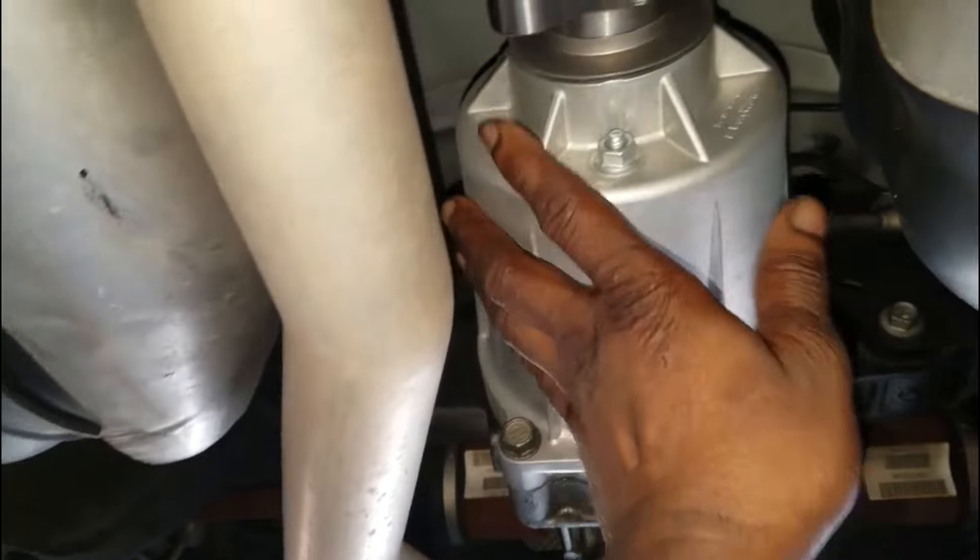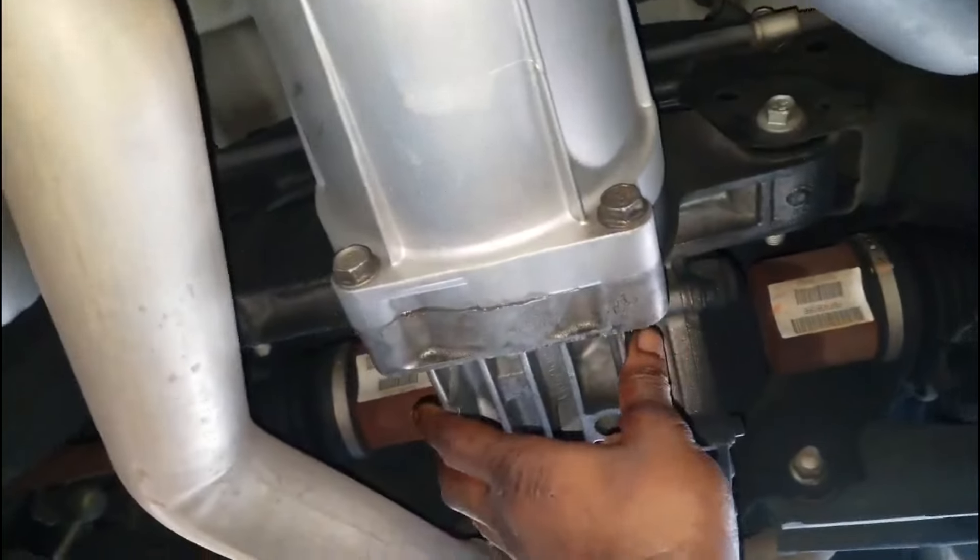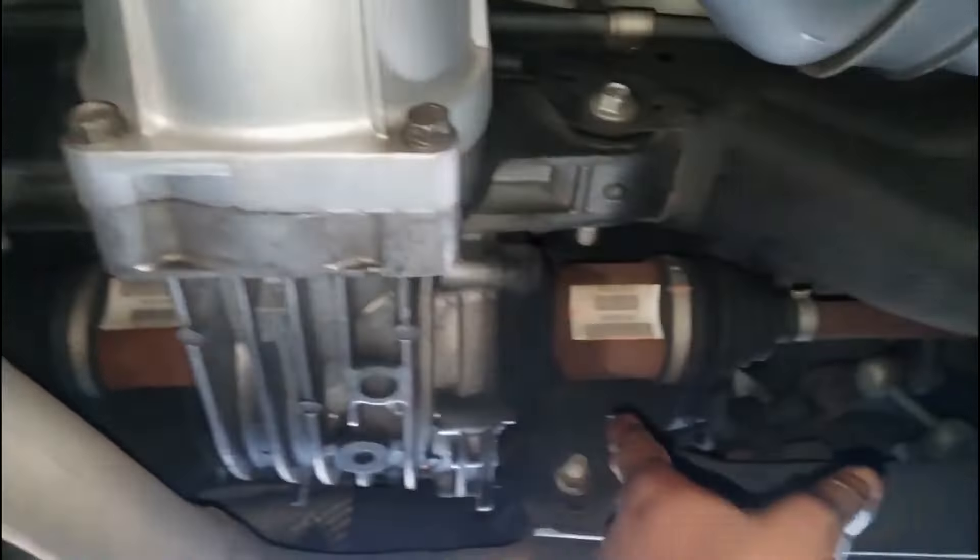Now back into the rear you can see a drive shaft going to the rear, which is attached to a viscous coupling right here. You should also notice it's brand new. It's attached to a differential, which is also attached to two more axles that transfer torque to the rear wheels. From these parts alone you could assume this is the all-wheel drive unit.